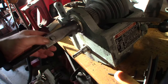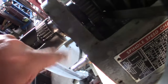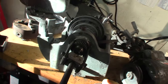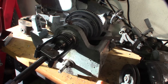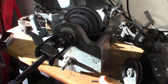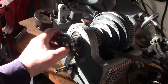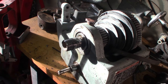I really hope I don't break this gear. I have a power steering gear puller that kind of wraps around the edge - it gives a larger load surface area to grab versus a standard puller. I have three jaw pullers, all kinds of pullers - I even have a bearing puller that goes around it. I'll try this one since this stuff is so brittle.